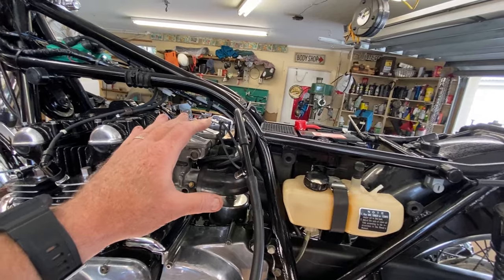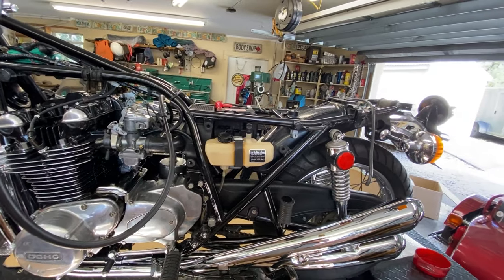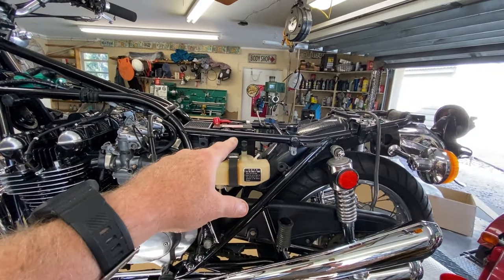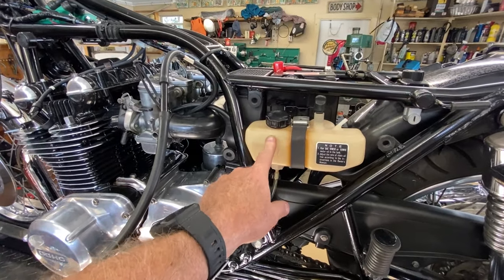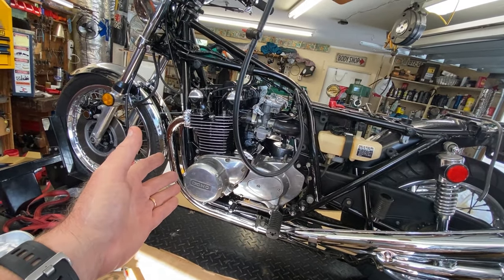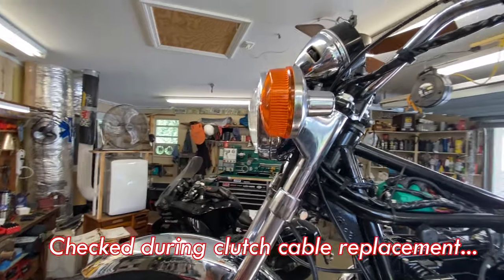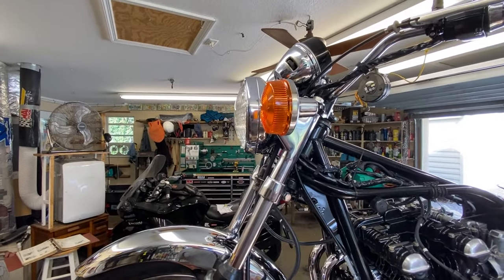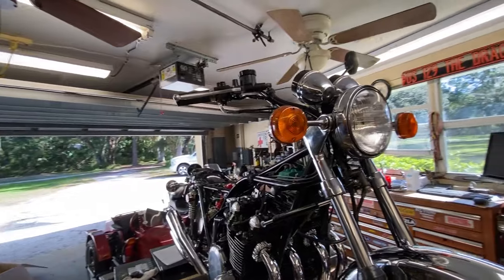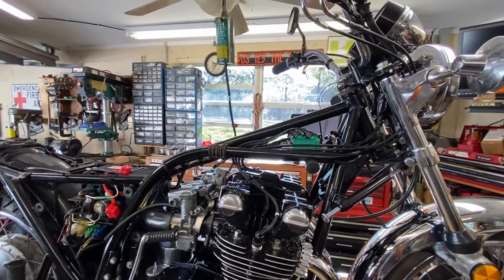Once the tank comes back, I'll make sure the fuel cock is good, fuel lines are proper length, check bolt torques, put the tail section back on, put the tool tray and everything back in, and put some oil in for the chain. I don't know if that little pump down there is working, but if I've got to pull the stator, I'll be pulling the side cover so I'll check it then. Electrically, everything works — the turn signals, brake lights, and so forth all work just fine. Oil and filter have already been changed, and the carb work is done as you saw.